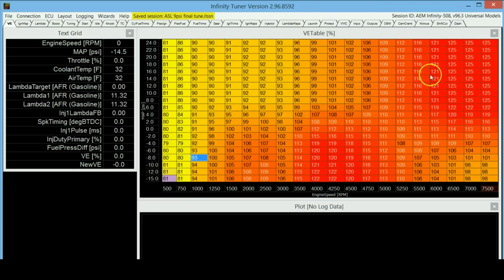So once I bring the peak volumetric efficiency down to this range, then that would mean that my torque curve would pretty much be flat all the way from 4,500 RPM to 6,500 RPM, and that's the best way to make the most, because it's pretty much running at its peak potential all through the rev range.